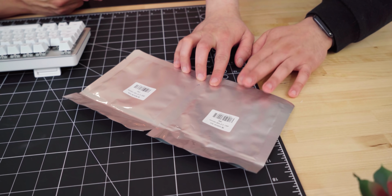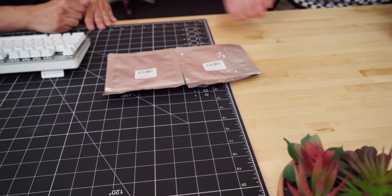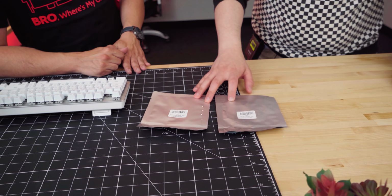Well, it's a very good thing that you did here because as you might know already, coolers and CPU IHSs are not perfectly mating. That's why you need thermal compounds. One of them is concave, the other one's convex, one of them is pitted, the other one's not. One of them has direct copper heat pipes, the other one doesn't. So the thicker you go with indium, the more meat you have to push through those nooks and crannies. So personally, I think that the 0.2 millimeter version will perform slightly better than the 0.15, but it is to be tested.